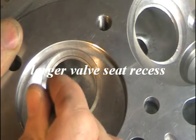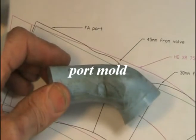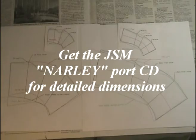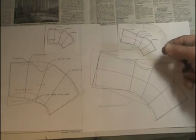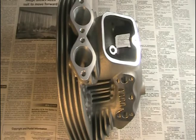This is a Harley XR 750 port — you can see it swells a little wider around the guide. We're not going to go this extreme but you get the general idea. For accurate dimensions and specifications you want to get the JS Motorsport gnarly port CD. These are printed out to actual size — exhaust and intake. You can see I've made a plastic template here that matches the roof of the Harley XR 750 intake port. After you've printed the AutoCAD plans onto printable plastic, you can use the template cutouts to keep track of your port shape.